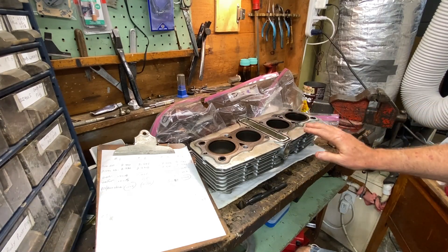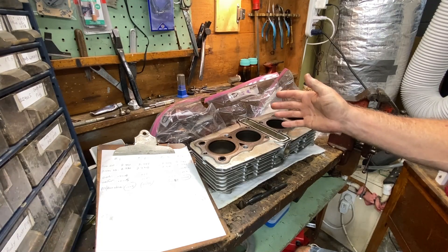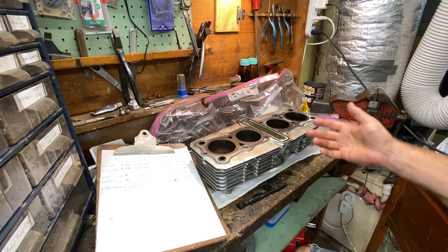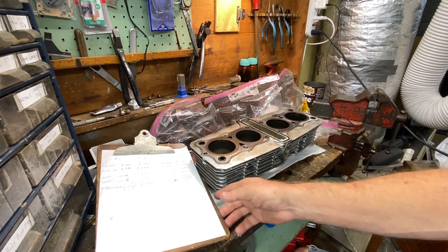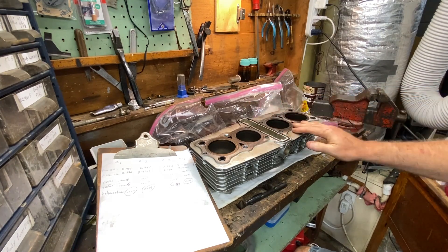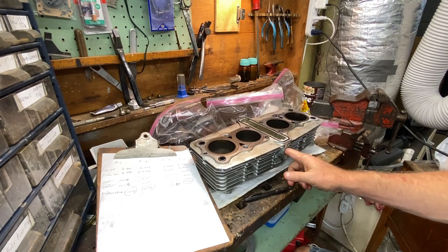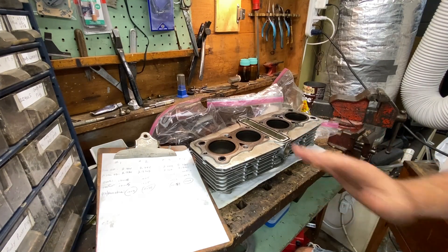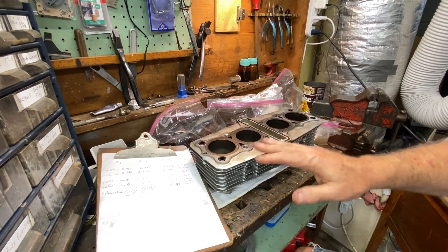So we're going to run it the way it is and put it back the way it is. I wish number three wasn't so far out — the others are a little over a thou out, since 0.0027 is just under three and these were at four, but number three is pretty bad. If it was a different machine — like an old Z1 or a 900 — I would most definitely say we're going to throw the money into it. But for this J motor on a police bike with an unknown bottom end as far as the transmission, we're just going to run it the way it is.